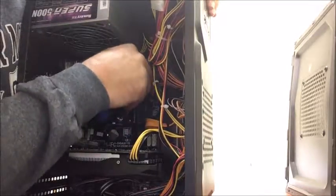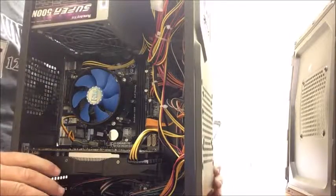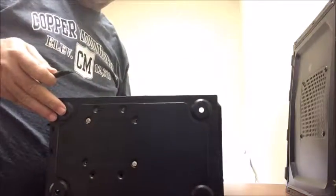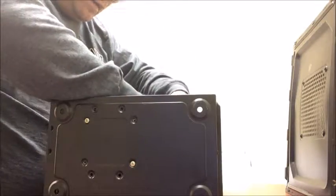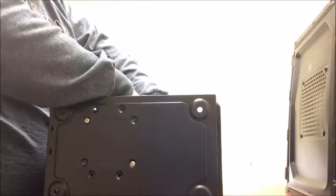This is to help fix the flashing blue light that you would have on the back of the chair. If you have a flashing blue light, you'd want to take this RAM card out and replace it and then hook it back up, and that should take care of your problem.